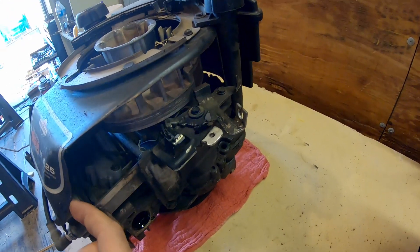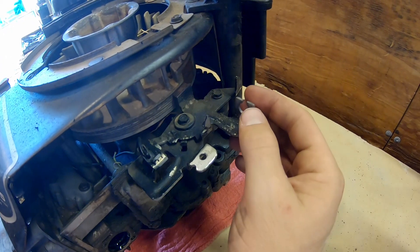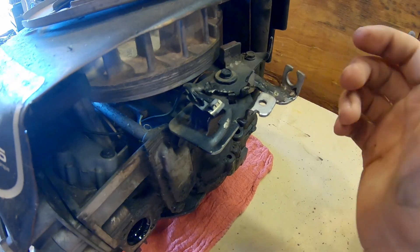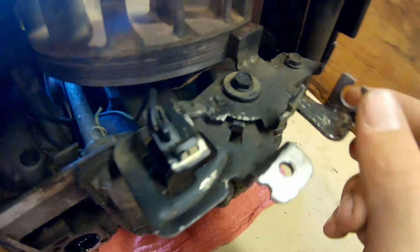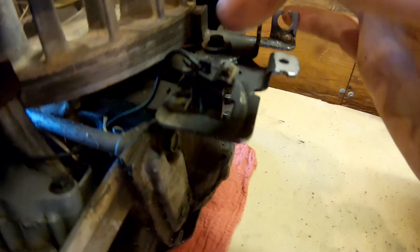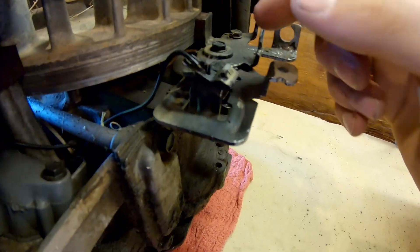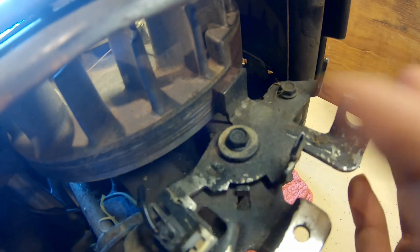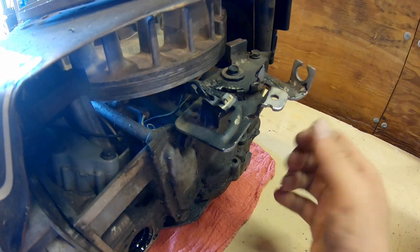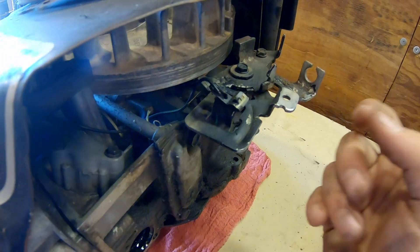The last set of modifications is that this entire side of the shield is ground away, leaving plenty of room to work where the brakes and safety cable would normally attach. The engine brake is still there but was never really in use. The safety cable normally lets the engine brake contact a grounded spot to cut spark and stop the engine when you release the safety handle. With no safety cable, it just sits open, and whenever I'm ready to turn off the engine, I take a key and ground it out myself.